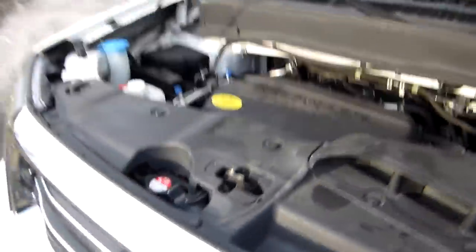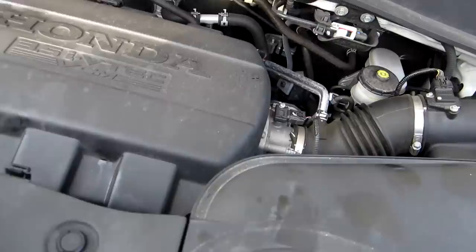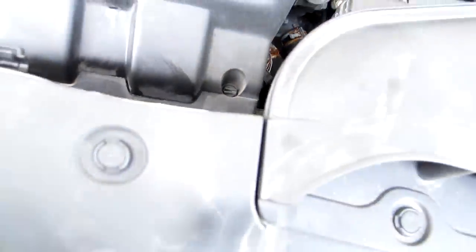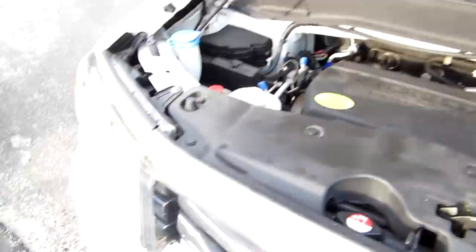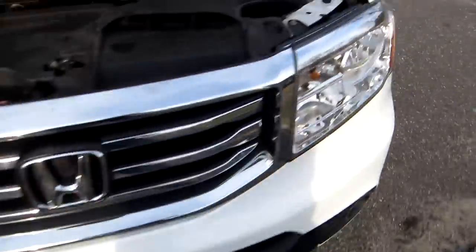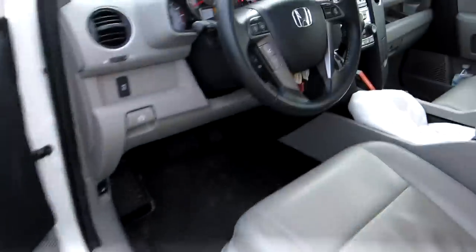I wound up finishing off the fourth bottle because there was a little bit of spillage. The design of this car makes it really hard to check the fluid levels, but the transmission fluid level should be checked while the car is running and at full operating temperature. We're all topped up and good to go.